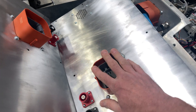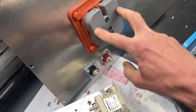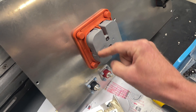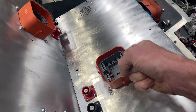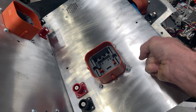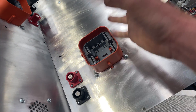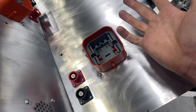So we put a removable fuse in the front pack. The fuse will be connected — there are two connections back here — and the positive of the battery pack will come through this to that pin. Until this fuse is put in, which will only happen once the car is built and the pack is installed, it will not be live. Some people use a disconnect switch, but you'd still want a fuse. So this does the dual job of being an on/off switch by removing the fuse, and of course it also serves as a fuse.